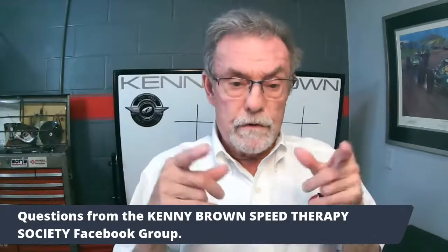So here's the thing. For a positive displacement supercharger, something like the Eaton, the Roush, the Whipple, or any of those positive displacement or screw type superchargers, pretty much they're all air to water. That's simply because the little exchanger packages pretty neatly underneath the supercharger, in the manifold area.